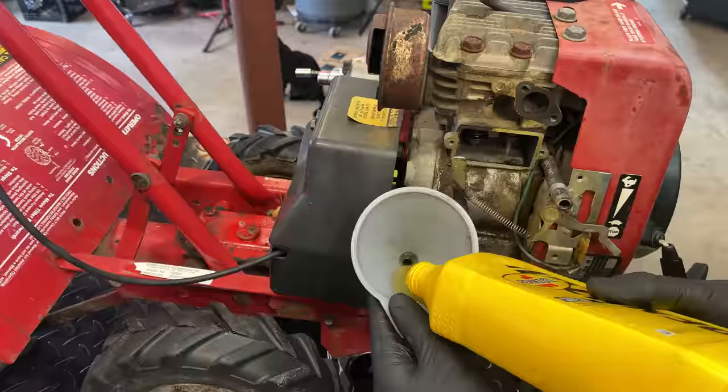Now, the last thing you can do, if you're checking the valve guide, an easy check you can do is just put your finger over the hole where the valve stem came out and pull the valve out real quick and listen for a pop. And there's absolutely nothing. So that tells me the valve guide couldn't build vacuum when I pulled the valve out. That's because the clearance is excessive in the guide and a vacuum could not build up.